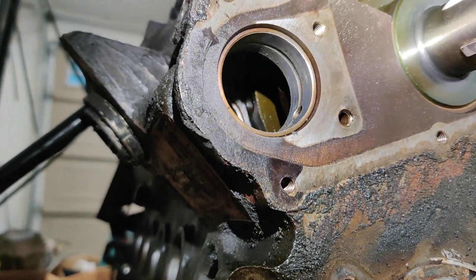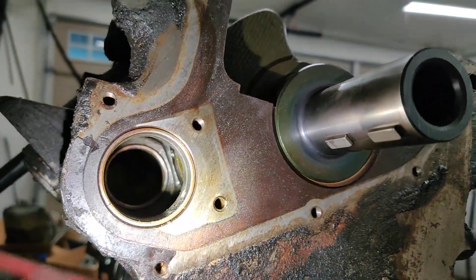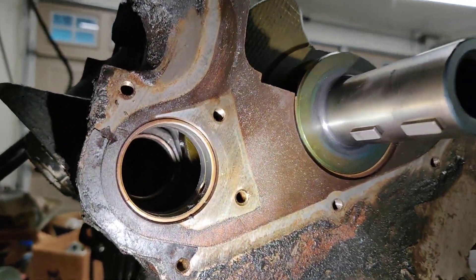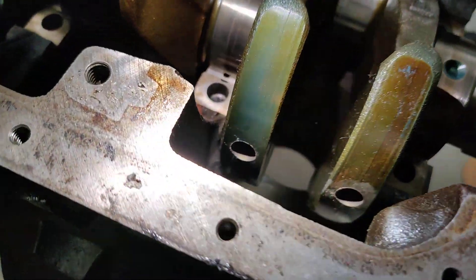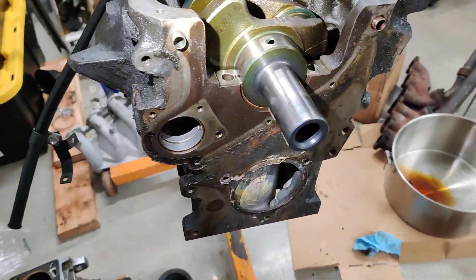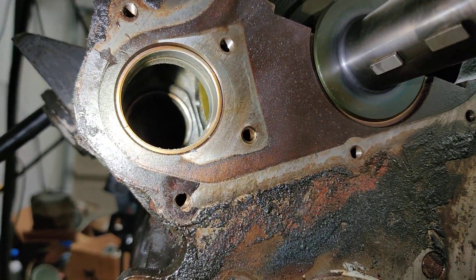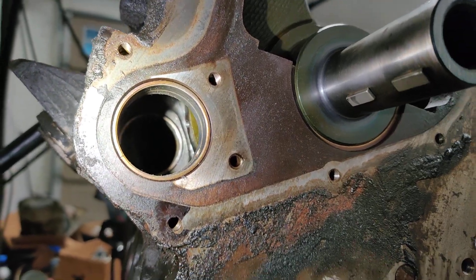Let me see if I can get it for you. If you look in here, you can see that there's just barely enough clearance in there. And you have to grind that. I know it's really hard to see, but basically down in from the top — you might be able to see a little bit better — but you have to grind that boss. It is a little bit tricky. I just ended up using a die grinder and cut it back. But you can see right there, that will get in the way.